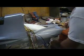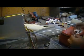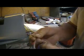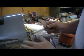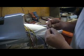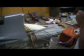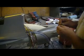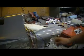But okay, time to get serious. Enough rambling. I just take my air compressor here, and this is actually a disconnect, but I use it so I can get a fitting on both sides. This is the air hose that puts the gear down and locked. This is the one I had all the issues with. Just go ahead and hook it up like that.